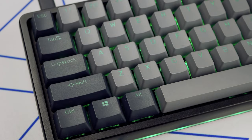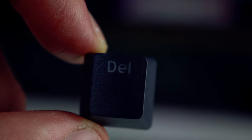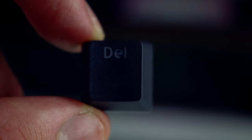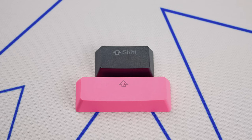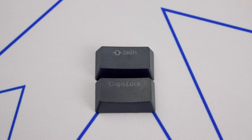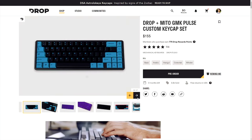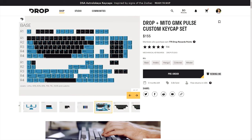The keycaps are surprisingly good quality and are backlit, which allows the lights to shine through nicely. They are made of PBT plastic, which is really good quality, and they are double shot, meaning the legend shouldn't fade very quickly. If you are looking to replace the keycaps, the right shift is smaller than normal at only 1.75 units, which is the same size as a normal Caps Lock key. A lot of GMK keycap sets come with this size shift key, and Drop sells a lot of them as well — just make sure the set you're buying includes a 1.75U shift key.